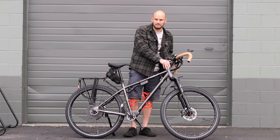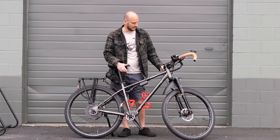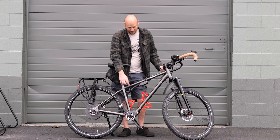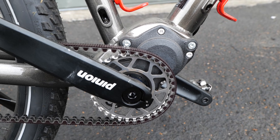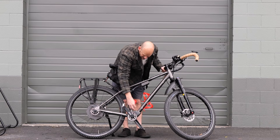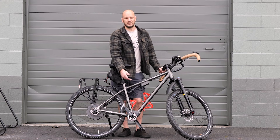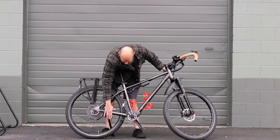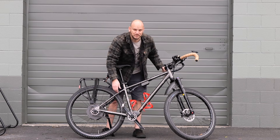This is a Priority belt drive bike. It's a really cool bike that had some challenges and a lot of cool stuff I want to go over. It's got a Pinion gearbox here — this is where the drivetrain is. Normally you would have an internally geared hub in the back, but this has the Pinion gear up front. I believe it has a 600% gear ratio, which is pretty awesome, so you get a crazy good low gear and a great high gear. With the belt drive, it's a lot stronger than a chain and it's super smooth and quiet.